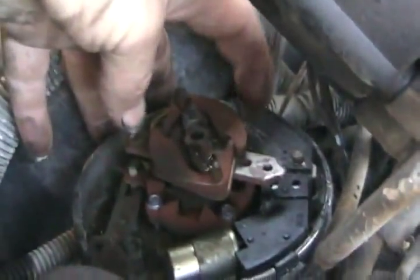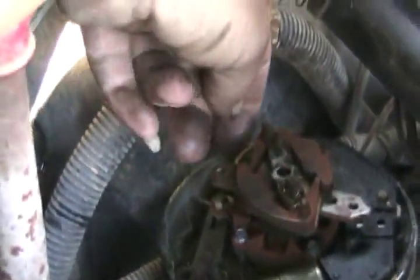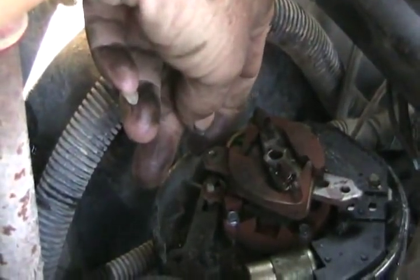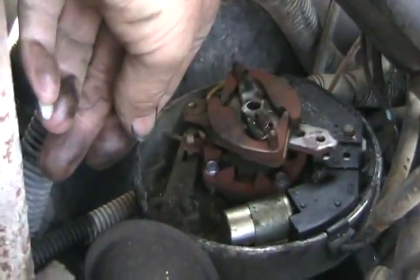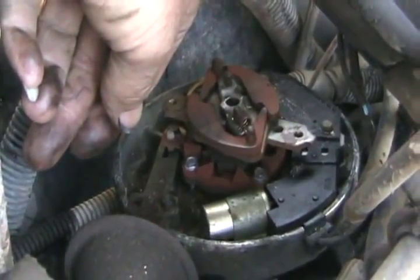You have your little green and yellow wire there — they go to your ECM and to the reluctor coil. When this thing moves for advance, it sometimes breaks those wires off. That's why one day you're driving your GM car, then all of a sudden it shuts off and you can't get it restarted, and there's no spark.